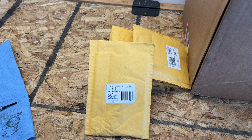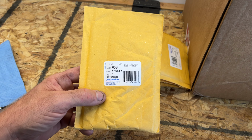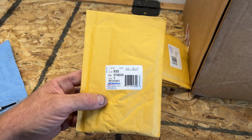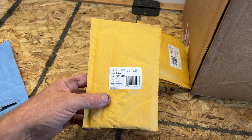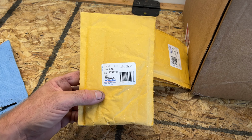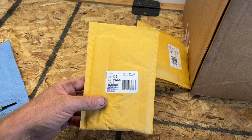All right, so let's go ahead and take a look at our new plugs here. Just went with the AC Delco 63G. Got these off Amazon. I'll put a link in the description for them. Since this is an 04, you guys need to make sure you buy the correct ones, because 04, I believe, is when they made the switch to the LLY, which is what this motor is. Some of the 04s would be the LB7s.